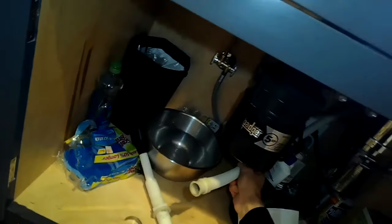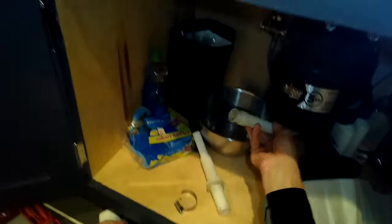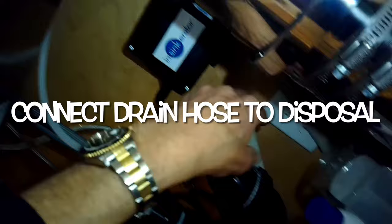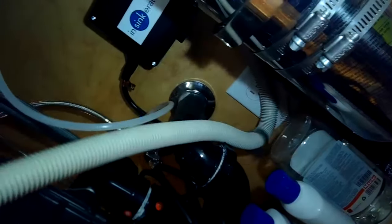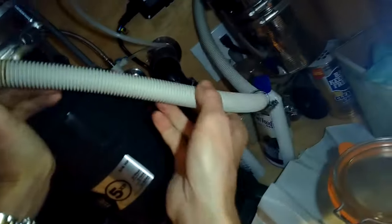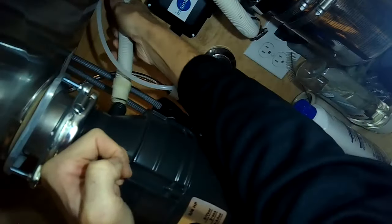This is actually what's done in Europe with Miele and Bosch dishwashers. Here in some parts of the United States they require air gaps, but they tend to cause problems especially with European models. What we're going to do is take the drain hose, pull it a little to get a bit more slack, and push the drain hose up as high as possible underneath the sink in a big upward arc, then put it onto the garbage disposal.